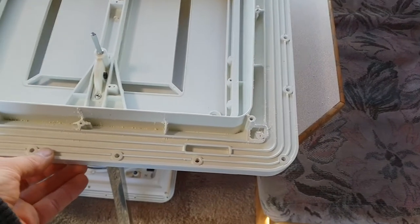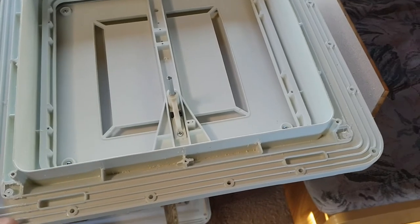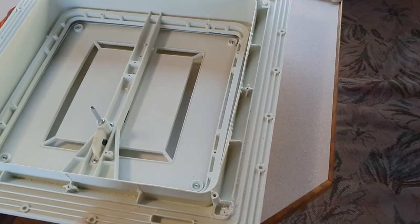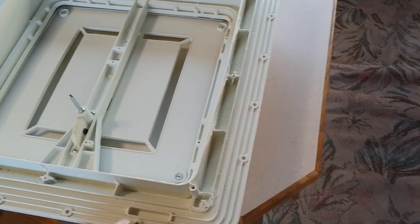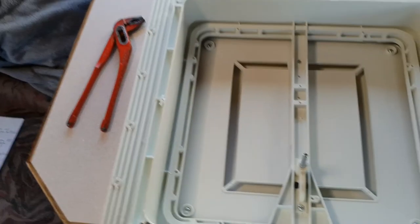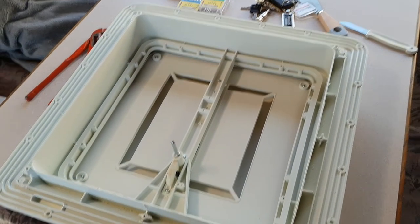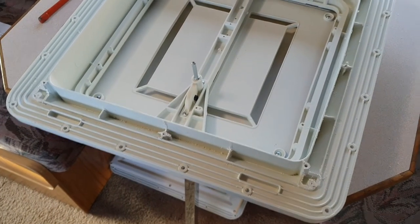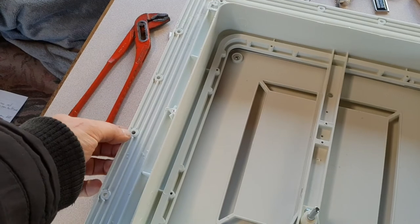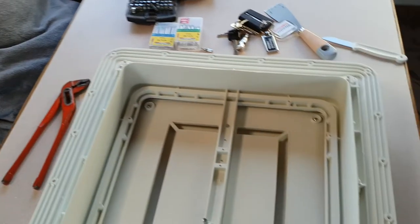But I do have to find out if there is roof support underneath there, or if it just goes over, because it's a metal support that I have in the roof. So I will have to drill in the roof with a tiny bit to see if it's in a support or not. I don't want any surprises, like not being able to get a screw in the first time, because that would ruin my roof again. So you have to drill in the roof for every piece, and just use a 1 millimeter drill bit to see if there's an iron support underneath or not.